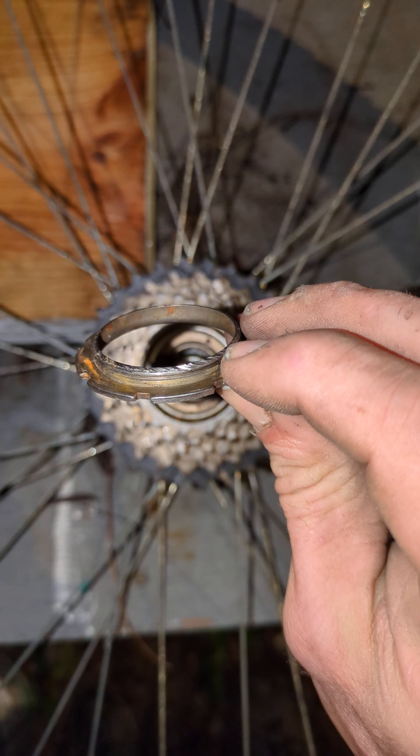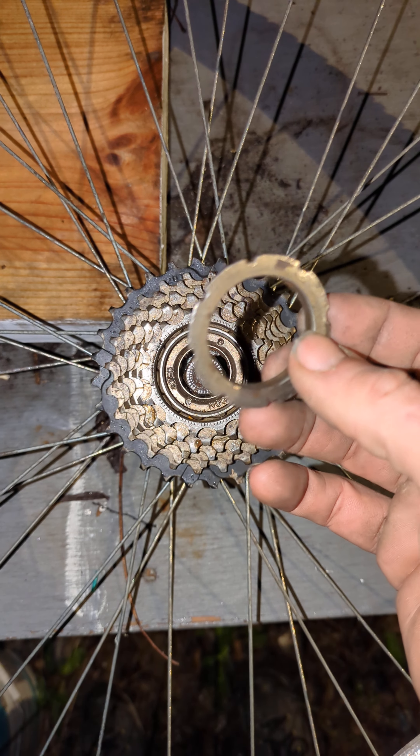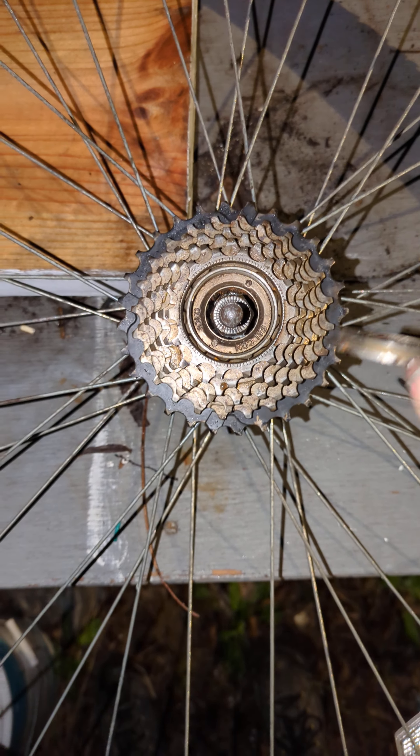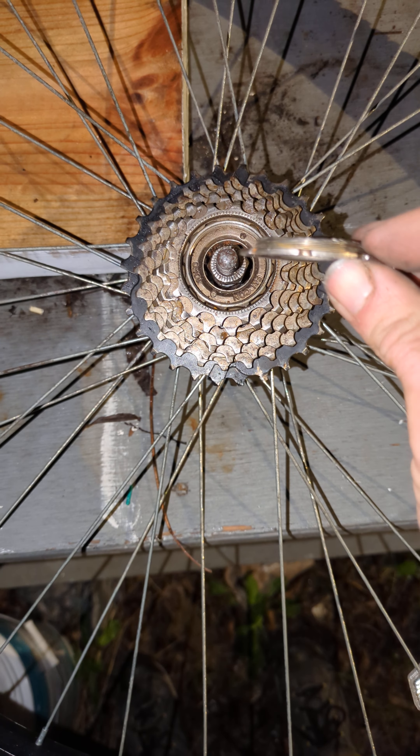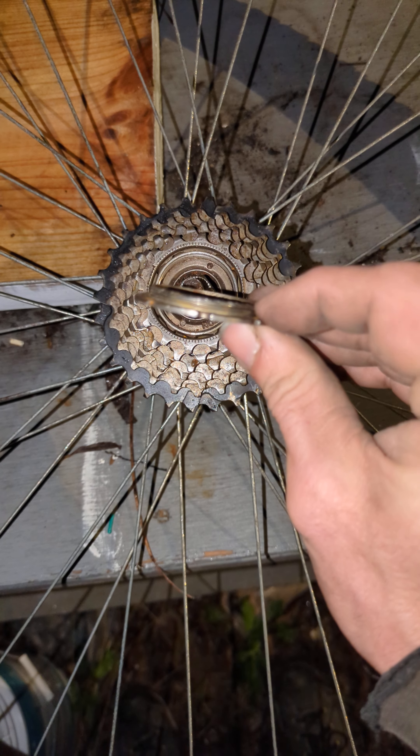See that? When I was looking up a replacement, I found out that this particular brand of bike — this Mongoose Ledge — is 12 millimeter with one millimeter pitch. It's a 12 millimeter diameter, one millimeter pitch.